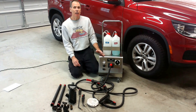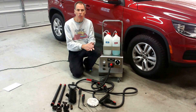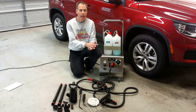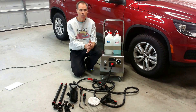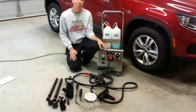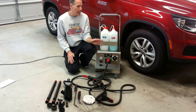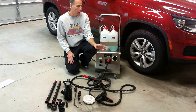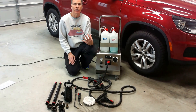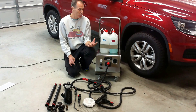What's different from the diesel is the injection feature. We're not giving you unlimited steam where you can use it for 10 minutes straight — that's not how an electric steam cleaner works. A steamer is designed to be cycled on for a couple of minutes and then allowed to recover for a little over a minute. This machine does that very well. The way we've designed the boiler, we've been able to not choke the steam off, so you're getting a full rush of steam through the hose. A lot of machines will choke the steam down regardless of gauge pressure, but if you're trying to get a car washed, you want maximum volume and pressure of steam coming through the hose.